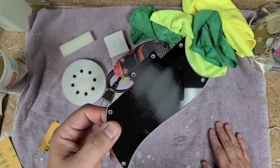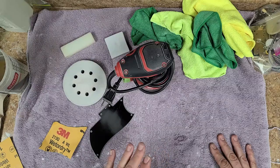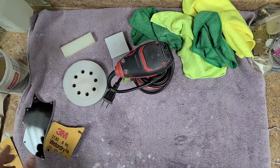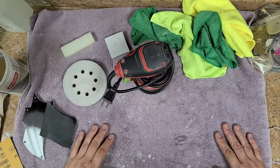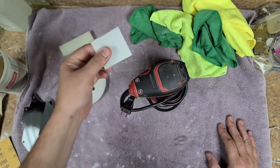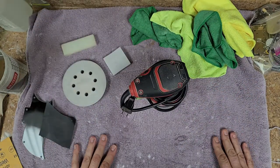The right way is to go side to side. As you can see, it blended in those finger lines. You don't want to go back and forth with a scrubbing motion — you want to go side to side. This plastic piece is proof of what happens either way. So for flat surfaces, don't use a foam pad for wet sanding — use something stiff and hard. Alright guys, take it easy, have a good one. I'll catch up with you later.